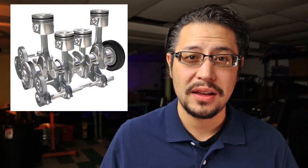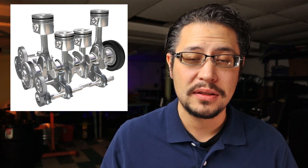The first reason you won't be tuning or building a four-cylinder naturally aspirated engine is because you need to spin the crap out of it. You need to increase the engine speed or RPM in order to move more air through the engine and increase the flow rate. In order to be able to spin the engine that hard, you have to upgrade the rotating assembly, which has a lot of components that need to handle extreme RPMs.